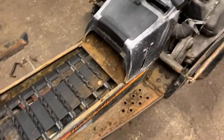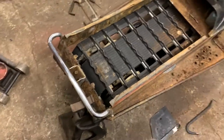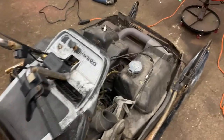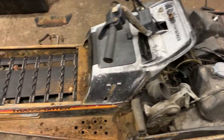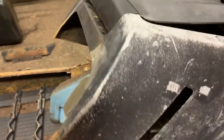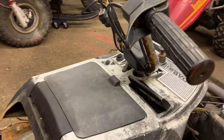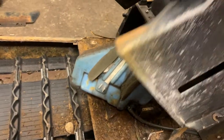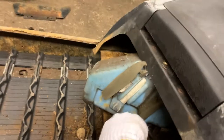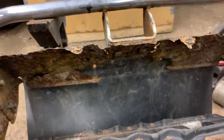Take a bit of progress — once we get this shroud off, get all this flat barred up and reinforced, we get some nice new galvanized metal there just for some structure and we should be in good shape. I was going to take off the full shroud but I only really got to fix it here anyways because it rusted out. So I found a little sheath — rather than let go everything and pull everything through, I'm just going to pry everything up out of the way. You can see we have our little tank here with a few hoses on it, so I'm going to tidy this all up. We're going to continue cutting, get this rusty piece out, and then add structure — do some welding and maybe cut out the rust back here and make a new piece for that.